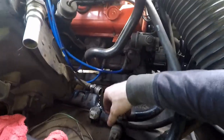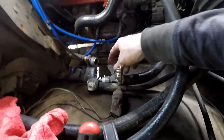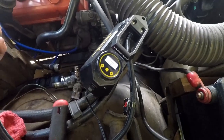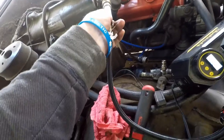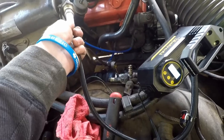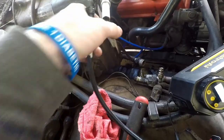That was a fight, but I finally got the nut off on the bottom. So now we can pull the POA valve out — it's pretty filthy in here, but that's why we're replacing this. I have a tire compressor hooked up with a fitting and some tape so it can blow air out. When I turn it on, we're putting pressure in the system — not much, but a little bit. There's a blockage in here, as you saw when it squirted back at me.